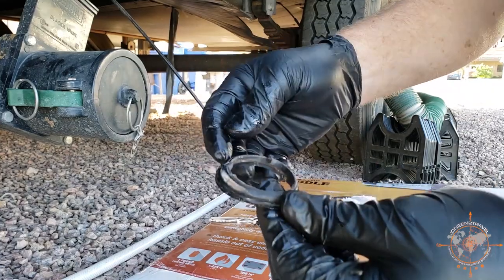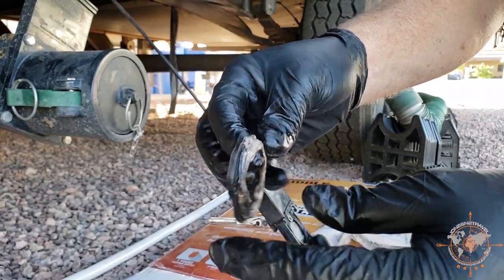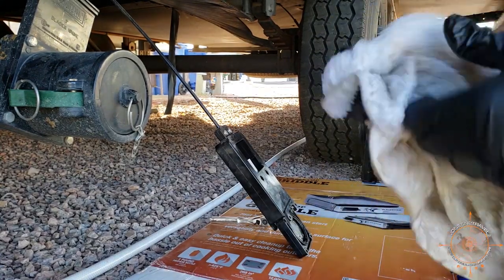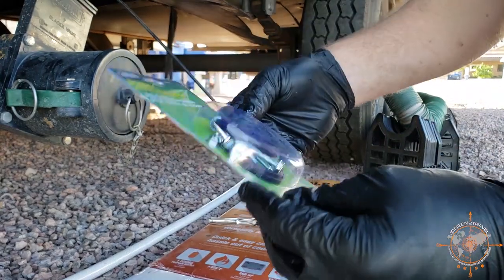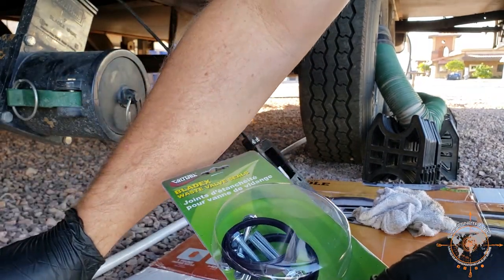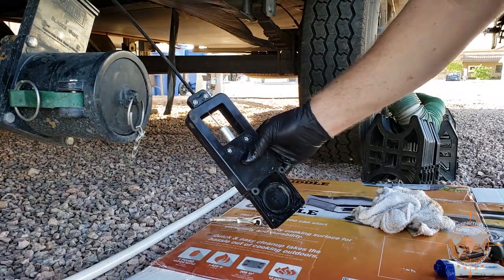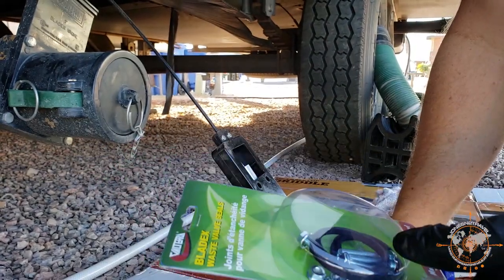You can see here that the front seal wasn't too bad — it's been pinched a couple of times. But the seal in the back — this is what was causing a lot of the trouble. You can see it was completely pinched in the side. Another thing I wanted to point out: in this new kit, you can see these bolts are really long. The factory length on most of them was cut shorter, so I'm going to reuse the shorter one because in the top rear the housing gets in the way. I'll replace the others with the new ones from the kit.